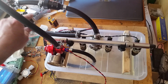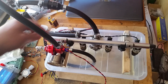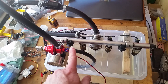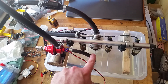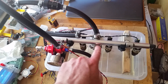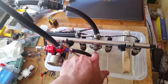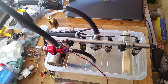The other line from the split goes onto the fuel rail and into the fuel injectors. I've also got some hose — this is the low pressure side, the other side of the pressure relief valve — coming down and straight back into the container. I've also kept the low pressure return from the fuel rail's valve going back into the case as well, just in case that ever does switch on.